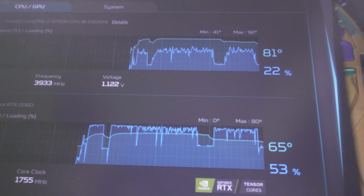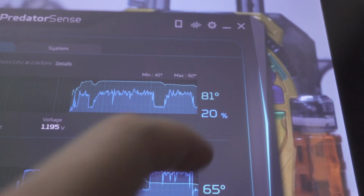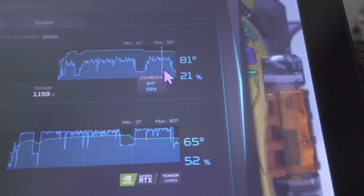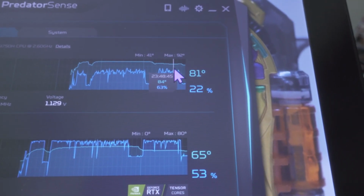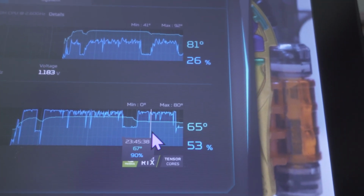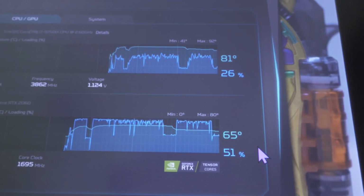But one thing that did get better, and that's probably because I cleaned up the fan, is that when I turn the fans to maximum, there's a very significant impact now. With my fan at maximum, the processor was running in the low to high 80s. It didn't go to 92, it was just sitting around 80 something, so that's great. And on the GPU side, when the fans are at max, it's chilling at 60 degrees. Interesting. At least some good was done.